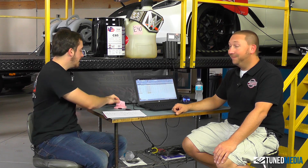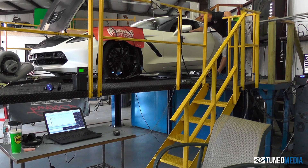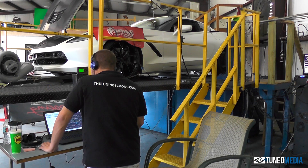What we did find with our car was just like with the E85 — we were so close to running out of pump, having that extra content and needing that extra volume, maybe even more. We weren't able to keep up with it. So what we actually did is we cut it down using 93 octane down to C40. It's not quite the highest concentration we could get, but actually kind of better, because we wanted to know what these punch out at at the same content level. So we equalized it — cut it down with 93, put it in the car, did our testing.